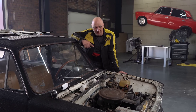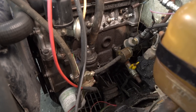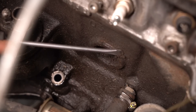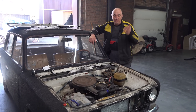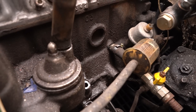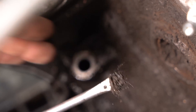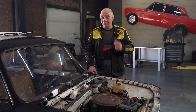So check this out. If you have a cooling system that is improperly put together — for example, if you have the fan in place but it's missing a shroud — that will certainly lead to overheating. A clogged radiator, but with the fan and shroud in place, will still overheat, for the same exact reason: not enough airflow through the radiator, insufficient heat exchange, and the coolant just won't be able to release the excess heat. Now, some of you might say we're missing something here. At the moment we have a dirty radiator and the engine is also covered in a layer of filth. A clean engine can also dissipate heat — not so much when it's covered in filth. So let's give the radiator a good clean, wash the engine block, start the engine once more, and see how it behaves.